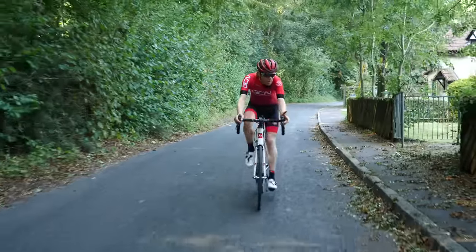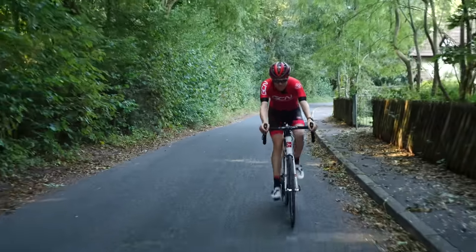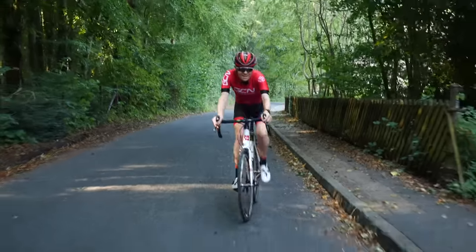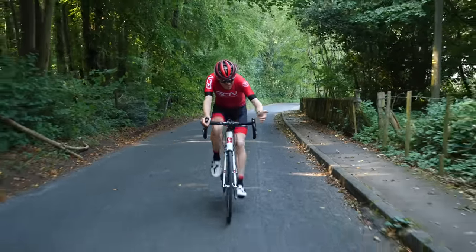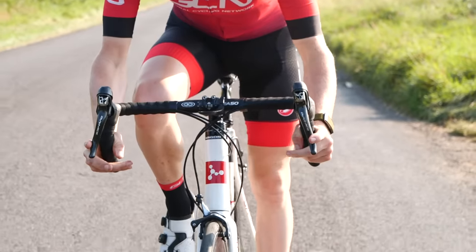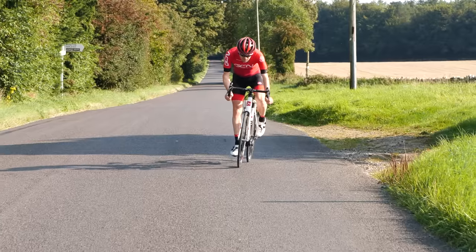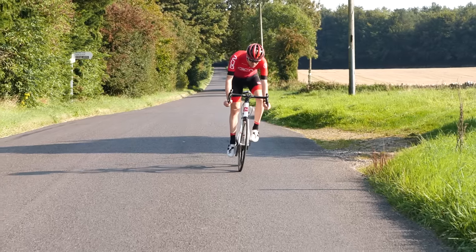And now, we were able to do that because the contact points on the two groupsets are pretty much identical. But it'd be a pointless exercise here because these Dura-Ace levers are so much smaller than the 105 ones. And also, this is 10-speed, and modern 105 is 11-speed.